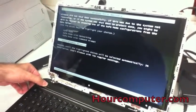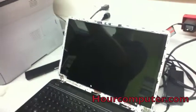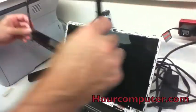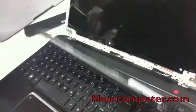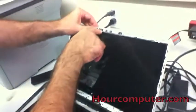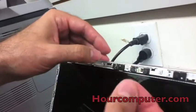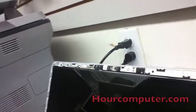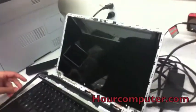Now we'll take the power out, then put the cover back on and we're done. We've got to make sure we watch these ones here. When taking it out, if you look up here for the camera — these are glued. A little bit of glue right there holds it in, so as you're putting the spudger in, be careful not to rip this out; otherwise you'll damage the camera cable. That's the only note we have. Now I'm securing it from one end and working my way over to the other side, and it pops in securely.